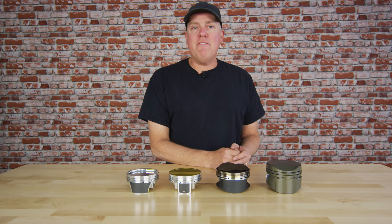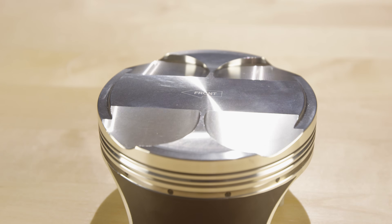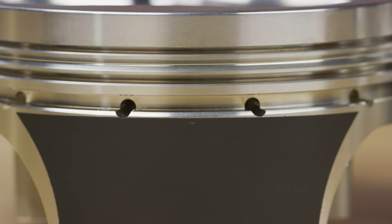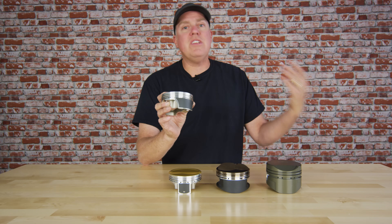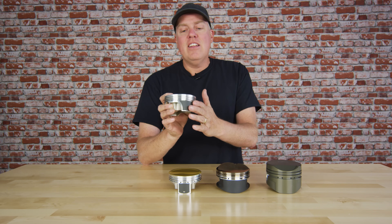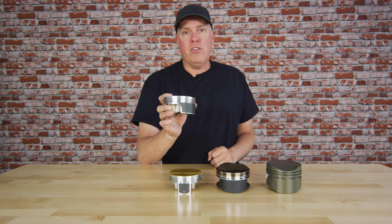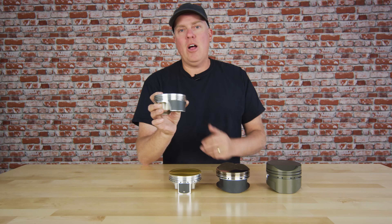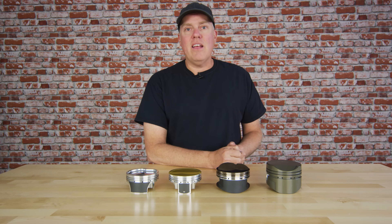Let's start over here at the very basic end with the SRP Pro Piston. These are all going to come with a dry film coating that is silk screened onto the skirt. One of the things they really want people to realize is that none of these skirt coatings are sacrificial — they don't disappear after the car has been running for a while. They're actually there in case you have a problem with oiling, where you don't get enough oil film onto the cylinder wall, and you might scuff a piston. That's just going to help prevent that. That is the most basic coating you're going to get.